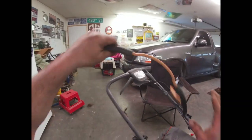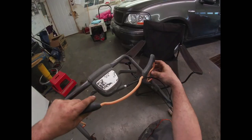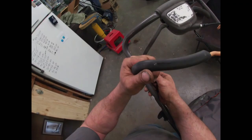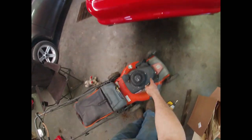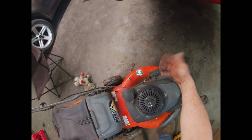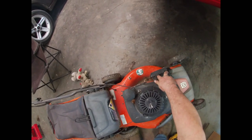That seems tight. We're going to tip her back over. I'll apparently break off my little dealie-boober here — which is no big deal, we just take this, put this side in, that side in — life is good. Something to mention: you'll see there's a little bit of gas that's dribbled out of there from the carburetor. That's why we shut the gas off — so that even if the gas drains out of the carburetor, it's only what's in the bowl and it won't continue draining.